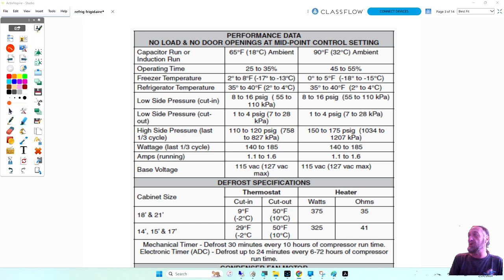Because you would say, well, hey, if my condenser's cooler, the compressor isn't going to work as hard. Yeah, it isn't going to work as hard because your compressor temperature and pressure is going to be lower if your condenser pressure is lower. And then in that case, your evaporator pressure is going to be lower, and you're not going to have a full evaporator. So again, that's important. I didn't want to get into refrigeration. I was trying to get to the schematic, so I'm going to keep moving here unless you guys have any questions.